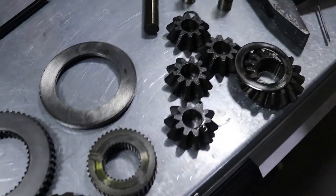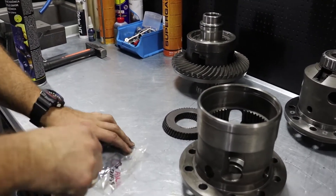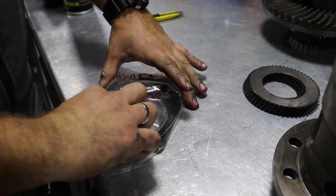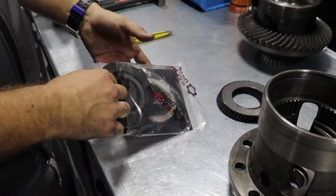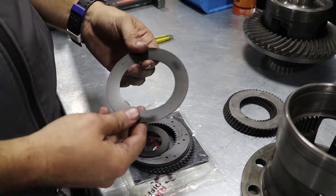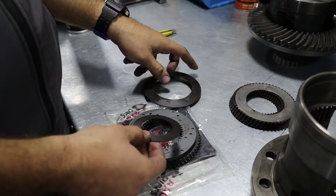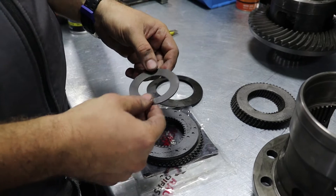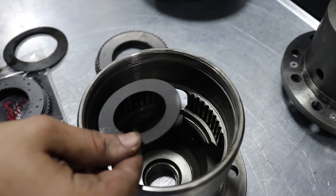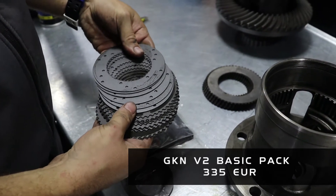These are all the internals. And now to show you what we have as an upgrade — what is different between the previous set and this phase 2 set. As in the V1 unit, this is the Mark 1 unit. The main difference is the spring shim — the preload shim — which will give your differential the necessary preload to work like a mechanical clutch type unit. You still have a free play shim, which goes in the bottom of the differential unit to help remove unnecessary free play from the output flange.